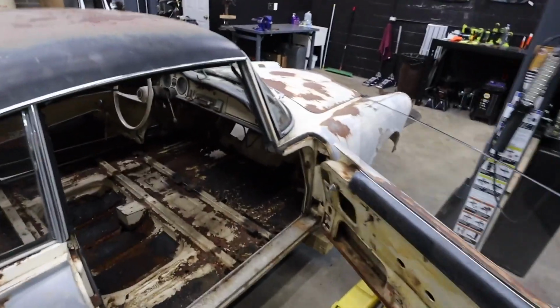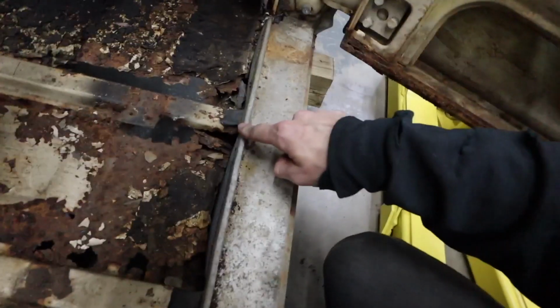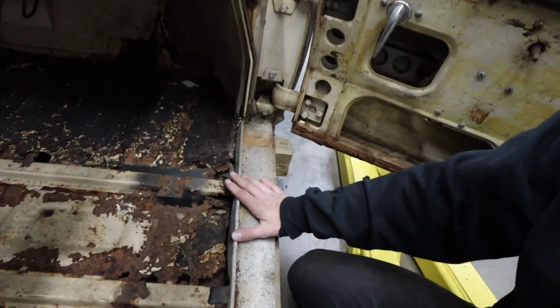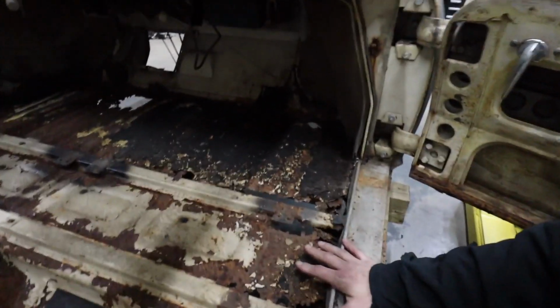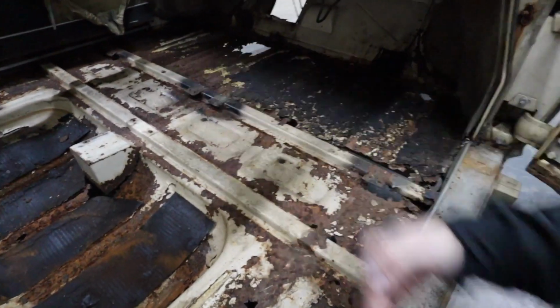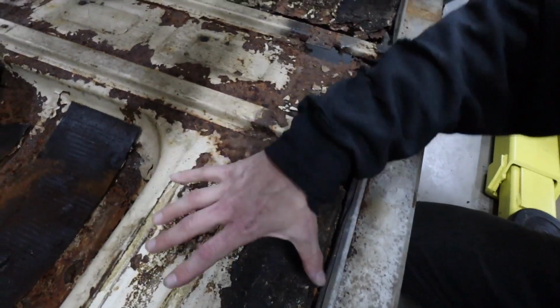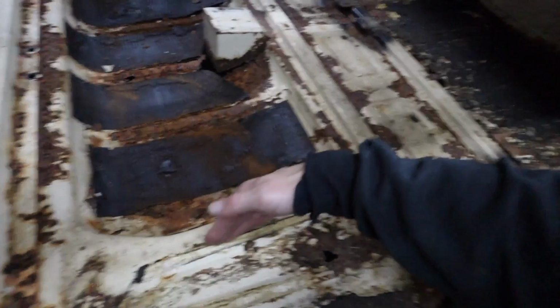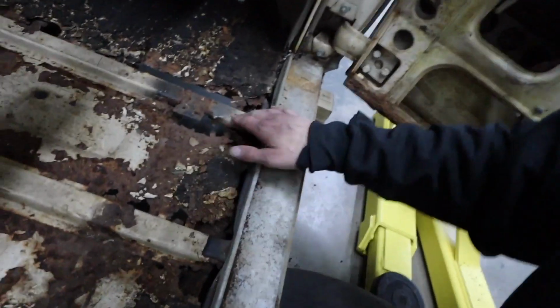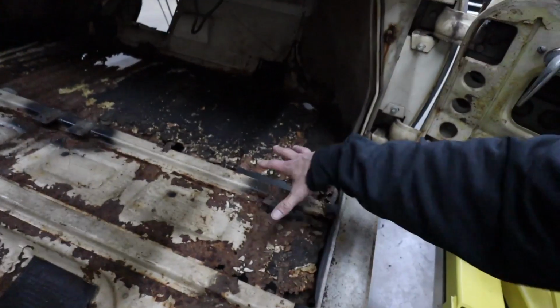All right, so here's what we're looking at in the interior. It's quite a bit of rust. Unfortunately, it's in places where I was really hoping it was going to be solid, because the Volkswagen Beetle pan is significantly narrower than the actual floor width of the 1000 SP, which means I was going to want to leave from the rockers in however many inches I'd need to. And actually, it was going to be before this tub. The pan comes to about here. So unfortunately, this is all super tender. Luckily, it's mostly flat. I can build in if I have to.